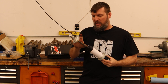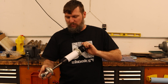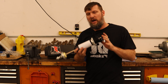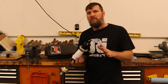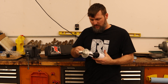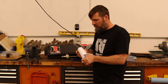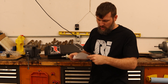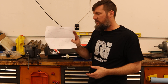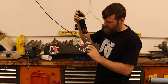This is the five-inch stroke one — five inches of stroke right here — so total extension is 17.5 and compression is 12.5. These are their Builder Series, made for custom builds. I did have to supply them the corner weights from the car, and then they did some custom valving. They supply you with a shock dyno chart, which is pretty nice — basically a force versus velocity chart.